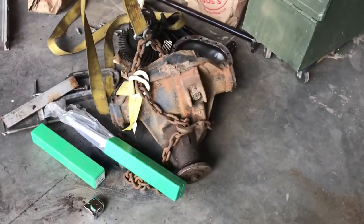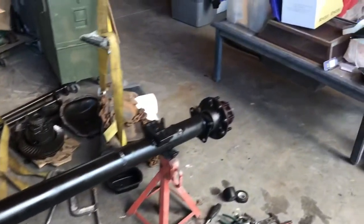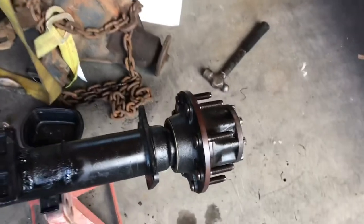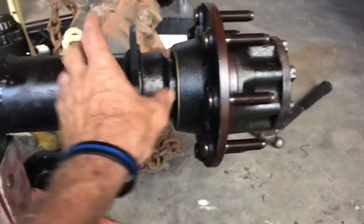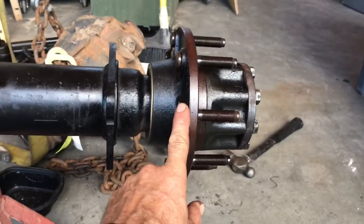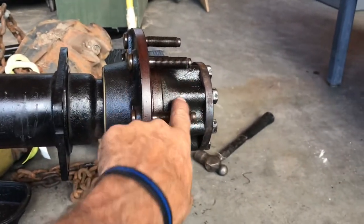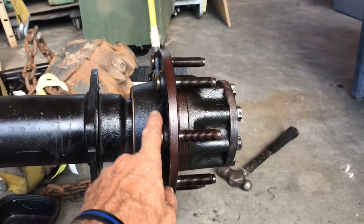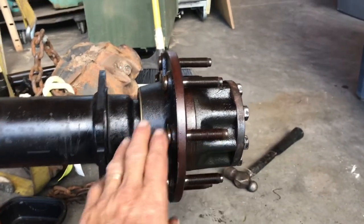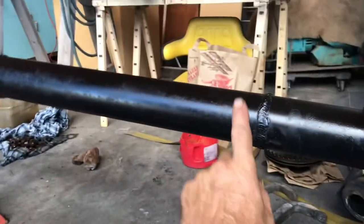That's what's left of my pumpkin right there — gotta get rid of that, it's a lot of weight you don't need. Here's my axle so far, I got one side together. What I'm going to use — because I took all the backing plates and all that stuff off — this is a non-brake axle. I like it because it's got really big bearings. I greased the bearings just like you would normally grease any trailer — pack them full of grease and put everything back together.